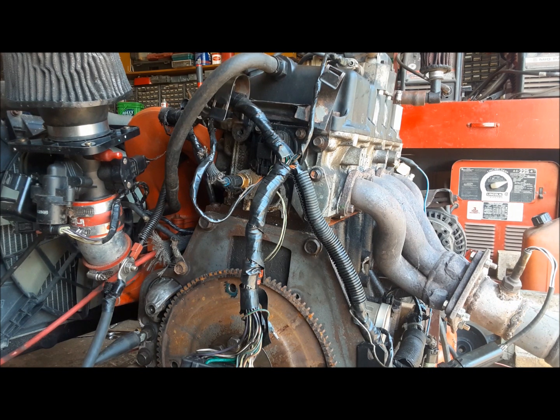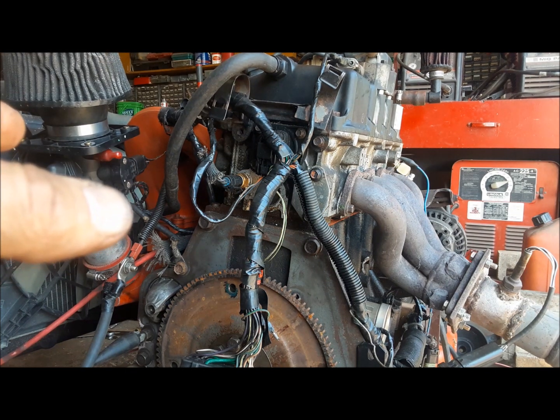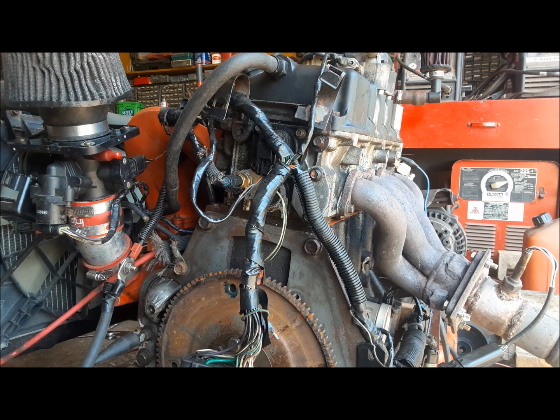But I'll tell you what, this little thing really runs good. It's just a stock SOHC engine, but it does have a Magnum camshaft in it. It's got a gutted Magnum intake manifold and a Magnum stubby header on it. And I tell you, for just a stock little engine, it really runs well. So we're going to fire it up now. Make sure it runs good, make sure there's no bubbles in the coolant, check the oil pressure, and go from there. It will run a little bit funny because I don't have a fuel pressure regulator on it, and I'm not quite sure the oxygen sensor is working. I don't have a check engine light on this. But it will run. So we're going to go ahead and crank it up. Watch your ears.